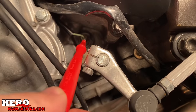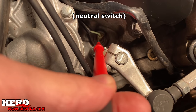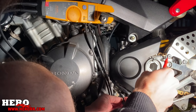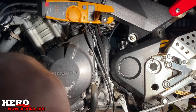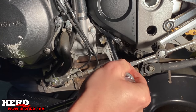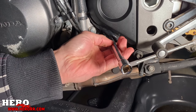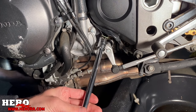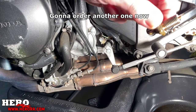Okay, so right here that little green wire — it's kind of hard to see but right there — I'm going to check continuity from this wire to the frame. I should be getting continuity and I'm not. The bike is a neutral switch issue. So this is the neutral switch, which I think might be bad.